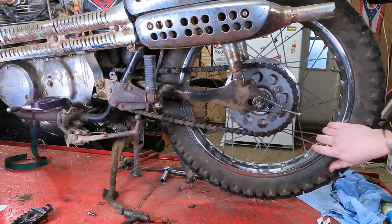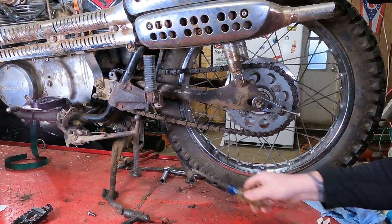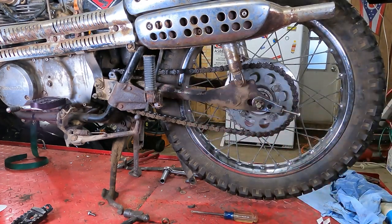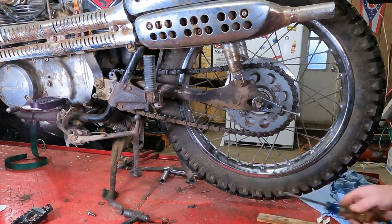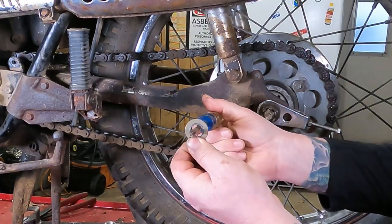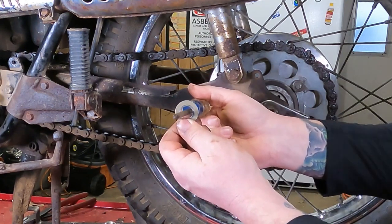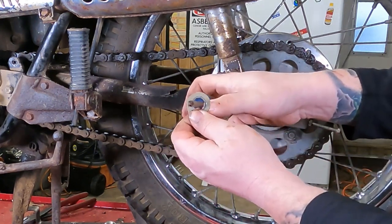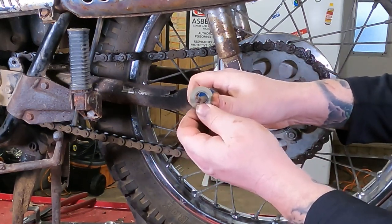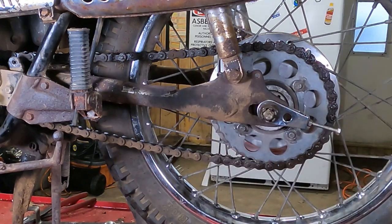But also, if it's super crazy tight — which I can only get it so tight here — that sounds like a good idea. However, the problem is you have to remember each one of these little links is basically like a little pin in a socket joint. Think of it in an exaggerated manner: it would be like this screwdriver through this washer here. If you have proper chain tension, the pin is through the center of the ring and it's floating on a film of grease. If you pull it too tight, the pin is going to go to the side, push all the grease out of the way, and cause it to prematurely wear out. Nobody wants that.